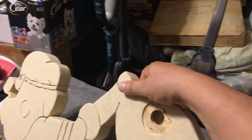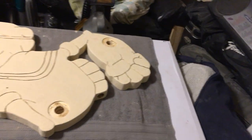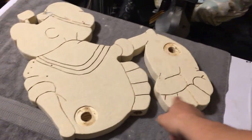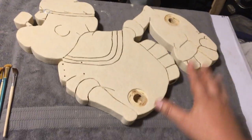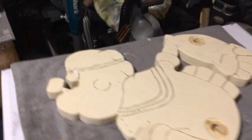Maybe pick up some dark primer. I think I'm going to go with a darker primer, probably black flat primer or dark gray primer. That way it'll fill in all these grooves and crevices, and I'll paintbrush it in. Then when I go to spray the color, there will still be remnants of it in the creases, and it'll make it easier. All right, it's looking pretty awesome.